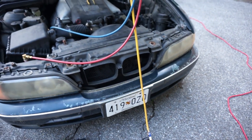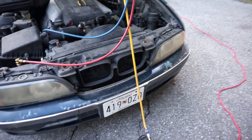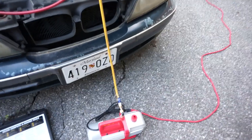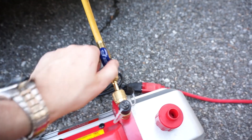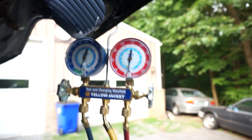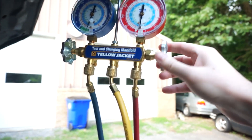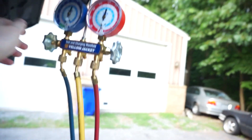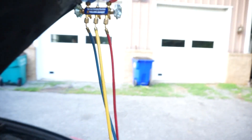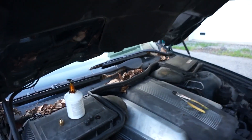Remember, that's going to vary depending on your altitude because this is not an absolute measurement — it's a relative measurement to how much atmosphere is pressing down on you. So we're going to shut the ball valve, then turn the vacuum pump off. The vacuum will remain in the system. At this point we're going to close our manifold, and now we're going to weigh refrigerant in.